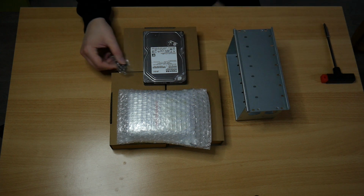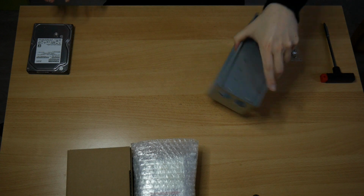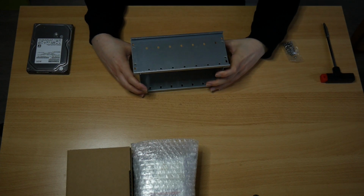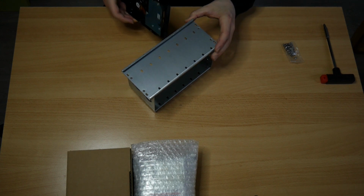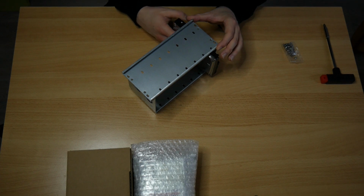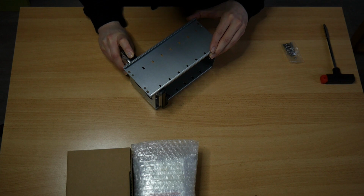At this point, the file server setup is basically complete. I just need to replace the broken hard disk, then everything should run fine. However, I actually don't like the way the disks are mounted in this chassis. It is a 4U case, and the disks can fit in there when in upright position. That way, the case can actually fit 2 120mm fans to cool the disks, rather than just one. It would also be nice if the drive cage wasn't such a tight fit, because then I could at least fit a thin sheet of damping material in between the cage and the disks. I think the lower writing speed could have something to do with the vibration. So when I get the new disk, I will try to install the disks in upright position with some vibration damping.